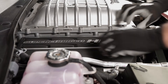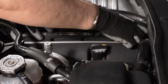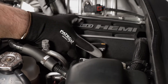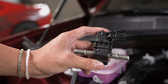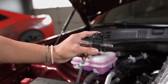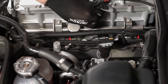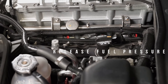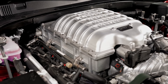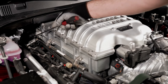To begin the installation, we're going to remove the covers to gain access to the fuel line and fuel injectors. Now that the covers have been removed, it's time to install the ethanol sensor. The main purpose of the ethanol sensor is to track the ethanol content blend in the fuel. Because we're installing the ethanol sensor to the fuel line on these Hellcats, you must release the relief pressure valve — this depresses the fuel in the system. Now that the fuel system has been depressurized, locate the fuel line by following the fuel rail. On these Hellcats, it's going to be on the passenger side.